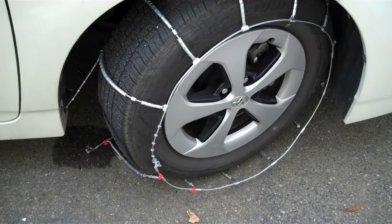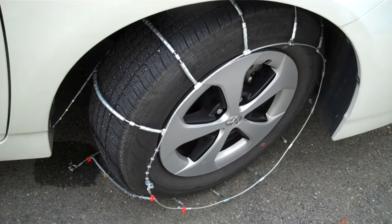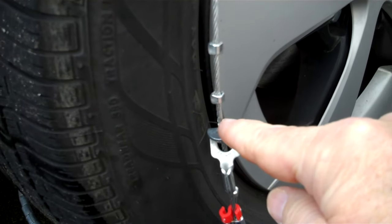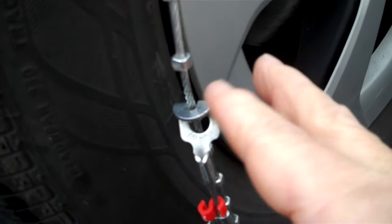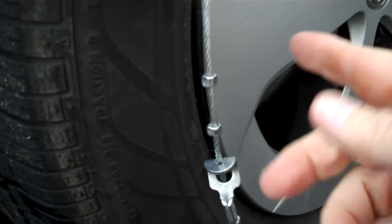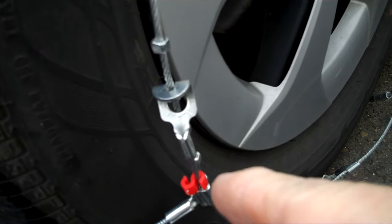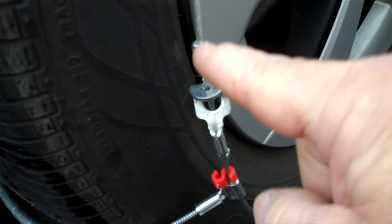When you get to this point, the next step is to turn your tire a little bit, because it's really hard to get to — especially with a Prius or any car that's tight — so you can have access to both sides. When moving up the rungs, they should never be more than one away from each other. Both sides should have the exact same amount — one variation is okay but never more than one. Both sides should have the same remaining. That's how you know if it's even — these markers will tell you whether they're even on both sides.